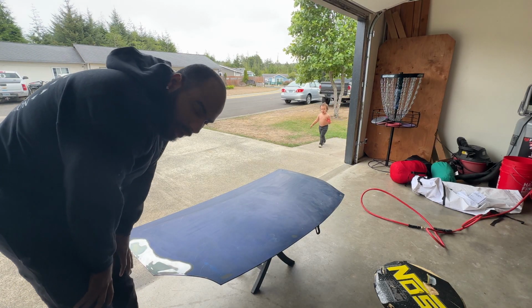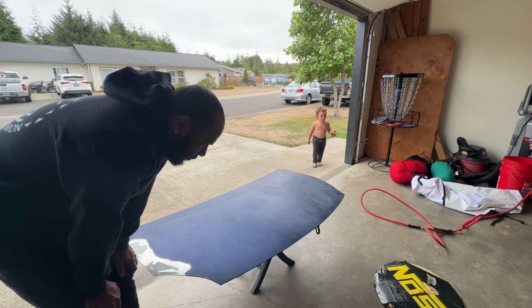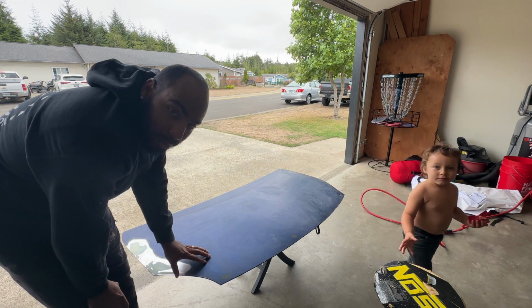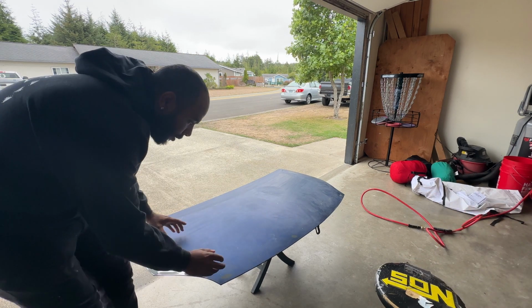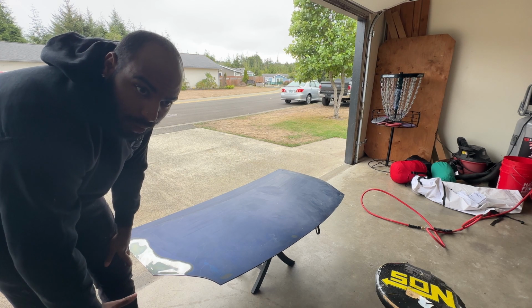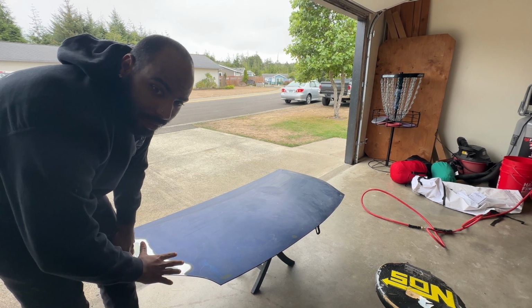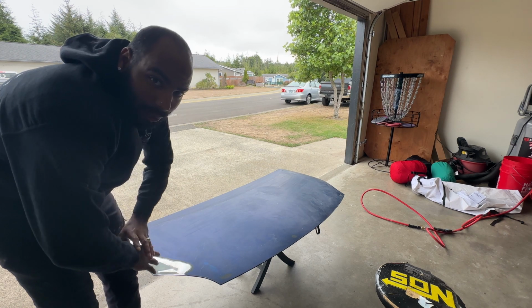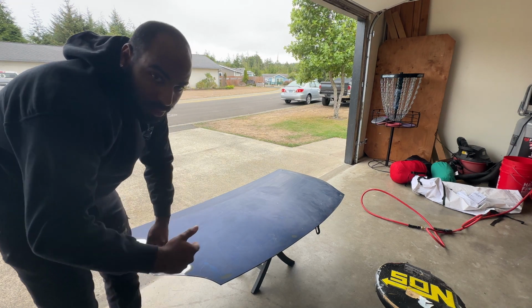All right, guys, we got the Prius all prepped right here. All I have to do is wax and grease remove, put some primer on this and some of these rock chips. And then I might plastic wrap it just so overspray doesn't happen. But after it's primer, we gotta wet sand it. So let's get to it.